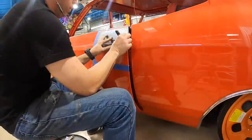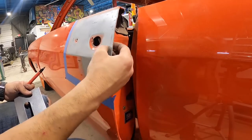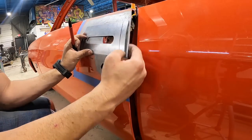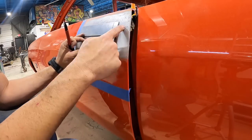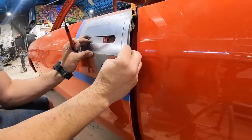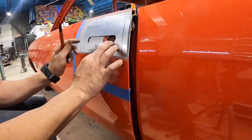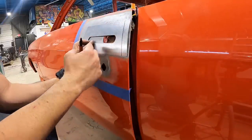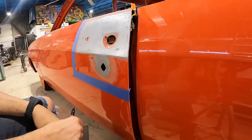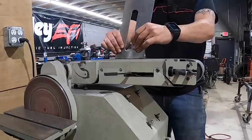I don't want to get into this lip — this rollover on the actual door skin — because it's going to be a lot more difficult to weld way out here. So we want to get inside of the door jamb into just normal sheet metal. I'm going to go ahead and cut this back along this body seam. What I'm going to do is cut this out first just so we have a good visual of the actual mechanisms we need to be dealing with, and then figure out how we're going to make the two pieces work together.